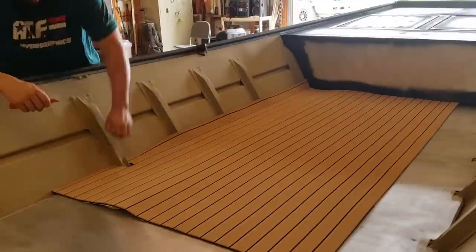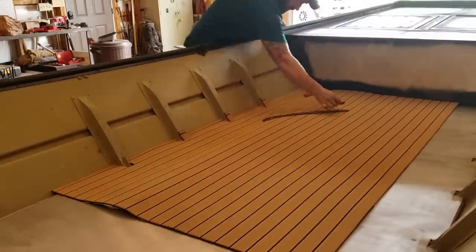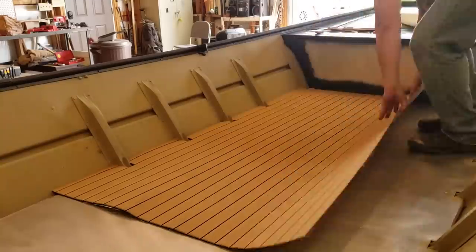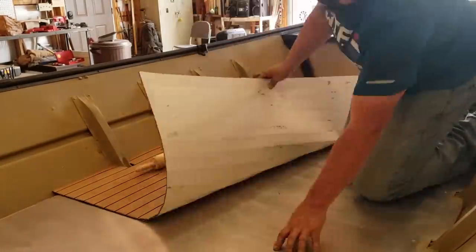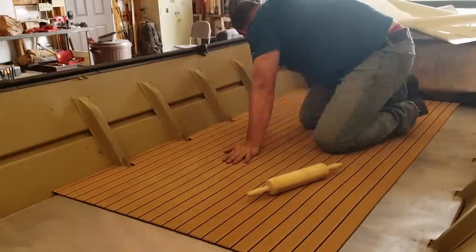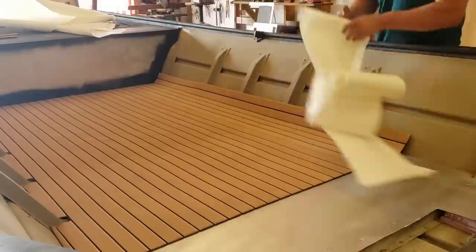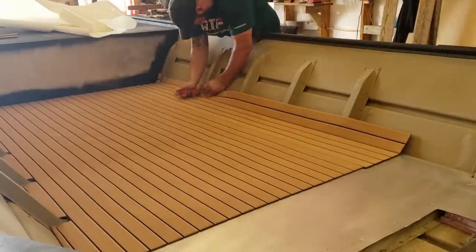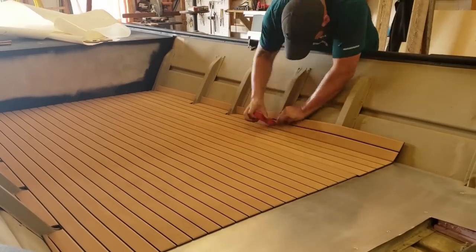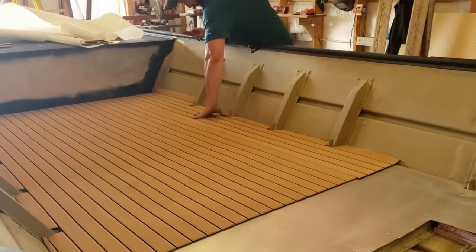When it's finally time to install the turf, it's super simple — just pretend you're in a giant Lisa Frank sticker book. A word of caution: the biggest mistake I made was assuming the sides of my boat were straight. I referenced the side of my boat for my first piece, and after it was stuck down and couldn't be removed without destroying it, I realized it wasn't straight. All my flooring ended up at a slight wonky angle. The best thing you can do is find the absolute dead center of your boat, mark a line, and use the lines in the turf to line up with that mark — do not use the sides of the boat as a reference.